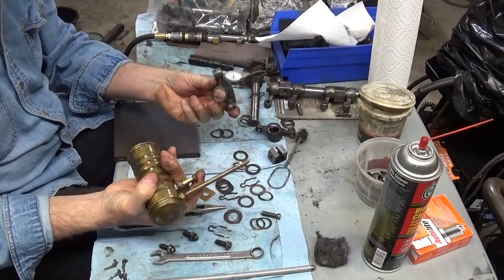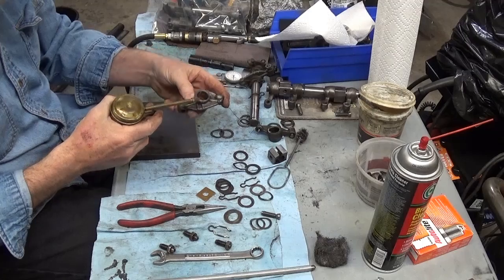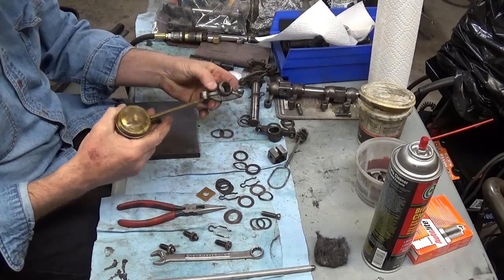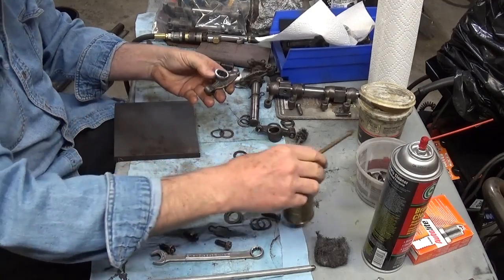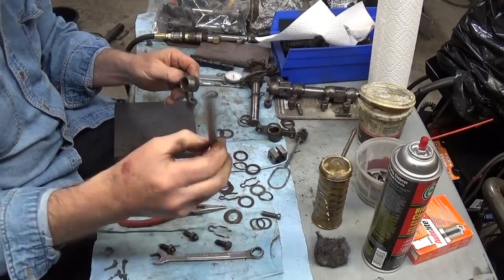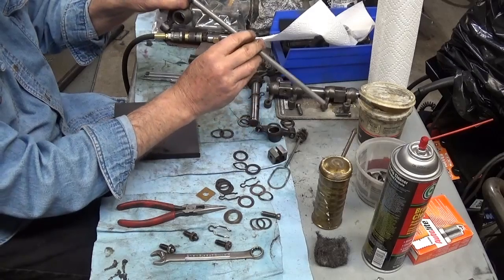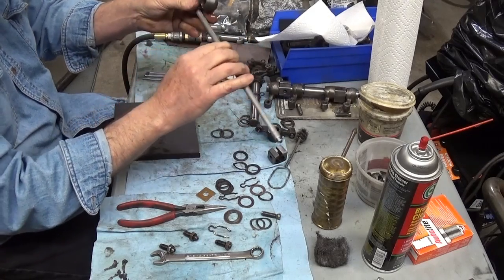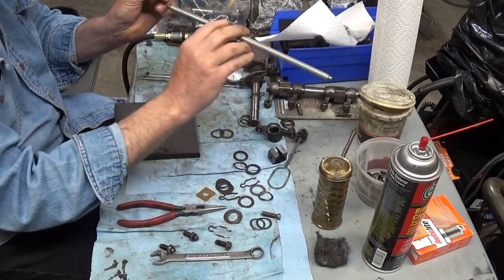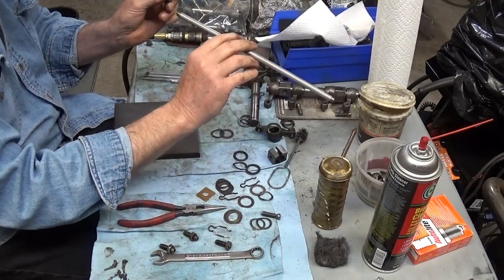up, I love this squirt oil can. Before you put this stuff on the shaft and reassemble it, squirt some oil in there, both sides. You'll notice that there's two holes in there. So the oil's coming up the push rod, right? It's coming up your push rod. This is actually, the push rod's on the bottom. So it's coming up the push rod, and every time this thing goes back and forth, in addition to your oil pressure, that's kind of acting like a pump.